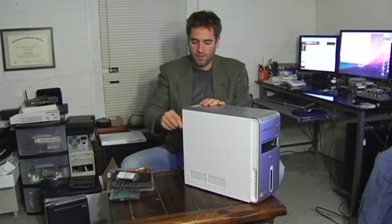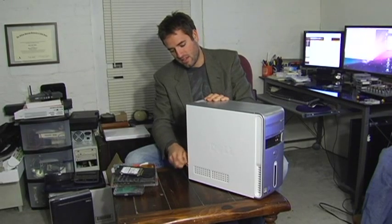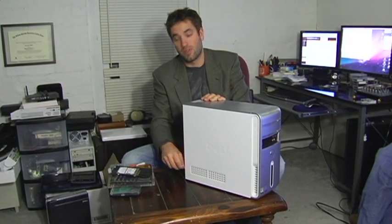Hi, I'm Gary Malek and in this video I'm going to show you how to replace an internal hard drive. It's always going to be the left side of the computer. You're going to remove the two screws out of the back and slide that panel off. I have little thumb screws in here. Some computers now will come with these — makes it nice and easy for you to get in and out. You don't even need a screwdriver.